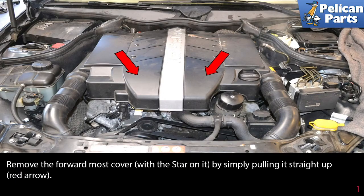You're going to be working around gas here, so let's do a couple of basic precautions. One: you should be working on a cold motor that's had a chance to sit overnight and relieve pressure in the system. You should be working in a well-ventilated area away from any open flame or source of heat, including incandescent shop lights.